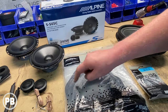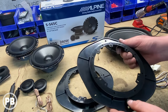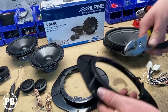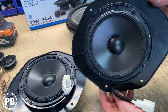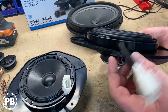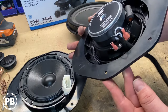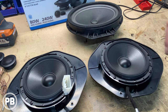We've got to get our speaker mounted within the bracket. These bracket adapters can accommodate a six inch up to six and three quarter inch speaker. The smaller-size tabs inside won't fit our speaker, so we can just break those off. We've built the speakers into the brackets, drilled a little half-inch hole on the side so our wiring harness has a space to go through and doesn't get pinched behind the door and bracket. We wrapped our harnesses in tesa tape just to protect them a bit more. Everything's hooked up on the back — the doors are ready to go.